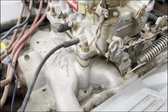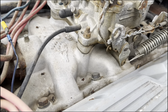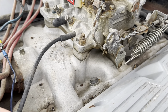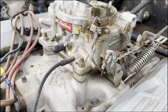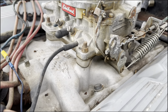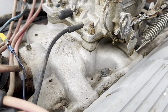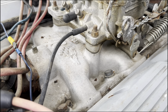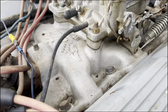I bought a thermal isolator, or heat shield gasket. I thought I needed a new gasket for my new carb — I've got a 1403, the 400 or 500 CFM. That one's definitely got a spacer so I'm guessing that's a heat shield. I'm not sure I actually need the heat shield or if I just need a regular gasket, so maybe somebody can let me know on that.